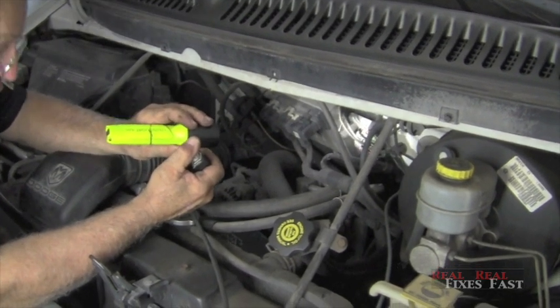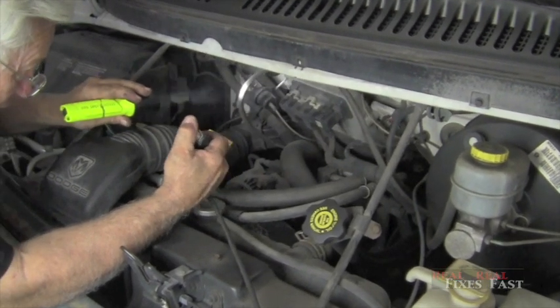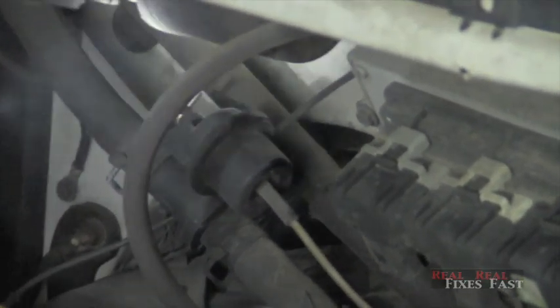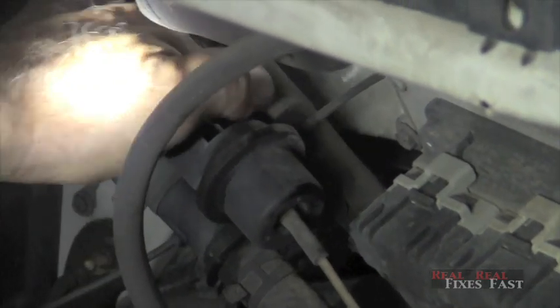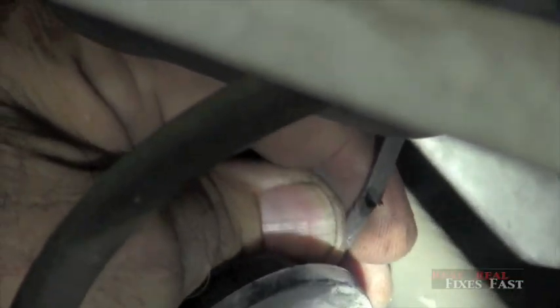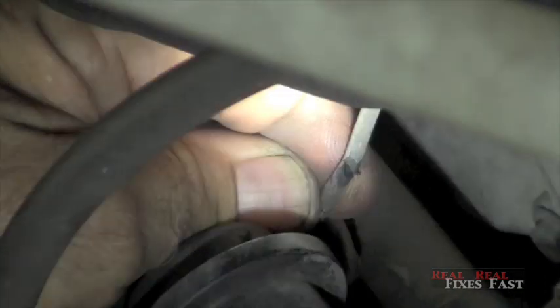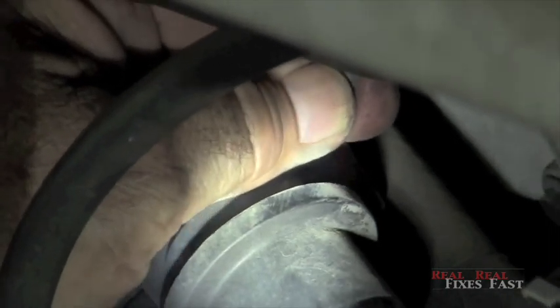I have found that sometimes the smoke is a little bit hard to see unless you have a bright light like this. But if we just kind of watch around down here — now we can see some smoke coming from over here. We've got smoke there, let's see if we can kind of zero in on that a little bit. Looks like it might be from this back line back here. Sure enough, right in here, you can see the smoke coming out right through that break in that vacuum line. This vacuum line is coming from the intake, so my control is not getting vacuum. I'm going to cut that, splice that together, repair that, and then see if the system works.